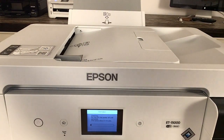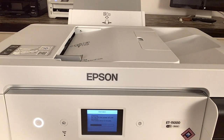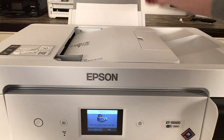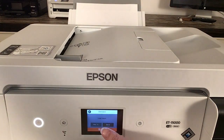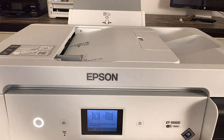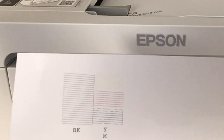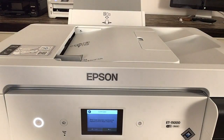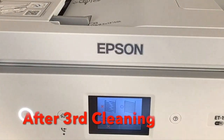I have some little gaps, so I'm going to pick the one that has gaps and hit X to indicate that's what I have. Now it's telling me I need to do some printhead maintenance, so I'm going to go ahead and run that — this could take about three minutes. I had only put one piece of paper in and it wants to reprint, so let me put some paper in. I still have gaps — they're better though. The first one had gaps in almost every line on the right, at least in the blue. The second one only has gaps in the top two lines of the blue, so it's getting better. But I'm going to press X again, meaning it's still not good, and do the printhead cleaning again. There are still a couple of breaks, but I'm going to move on because I can always go back and do another head cleaning.